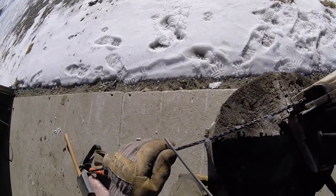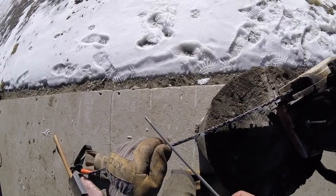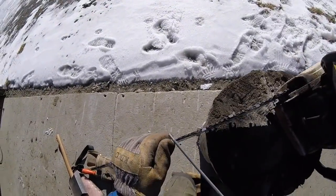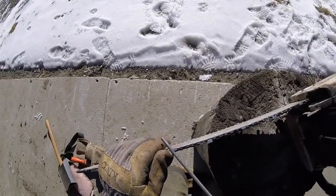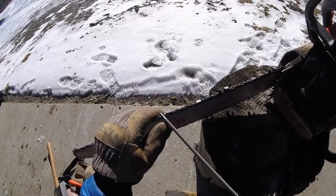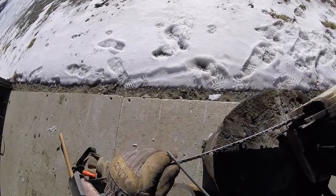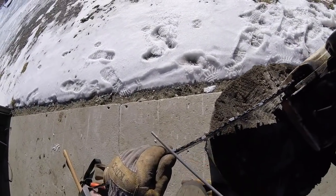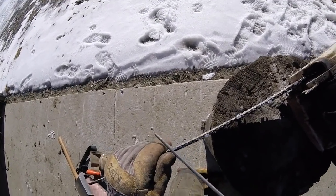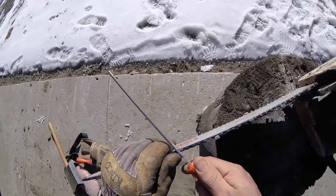And then I will use a Dremel tool to true it up sometimes and really get them back right, but I don't know. People go back and forth on this a lot. You do want to push down a lot, because what will tend to happen by hand is you'll migrate up and you'll end up not cutting straight across enough, but up, and the teeth will get really small and you'll only be using the top of them. So that's why a lot of people say you have to use a jig or you won't be able to have that be right, but I don't know. I don't like the jigs that much. And obviously, the less you need, the better for everything.